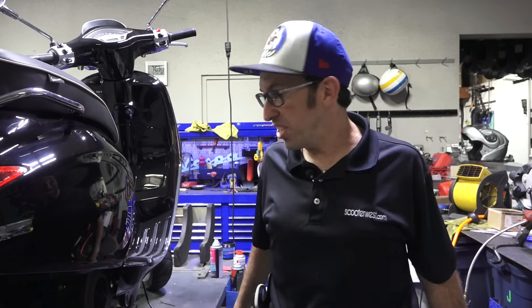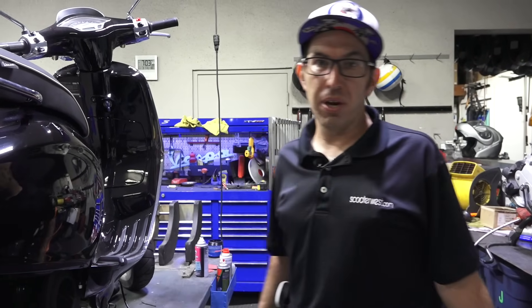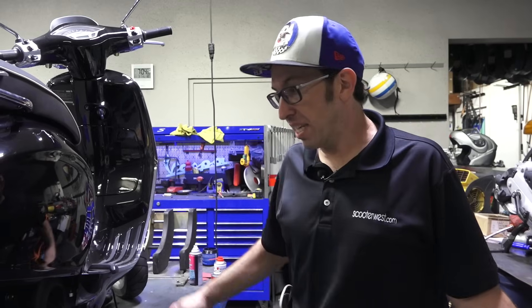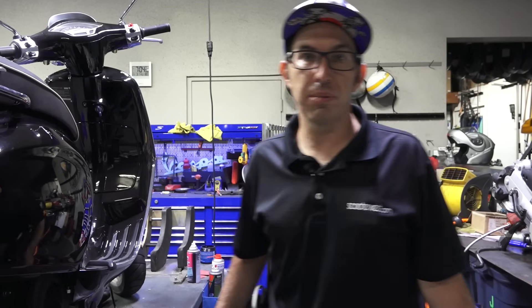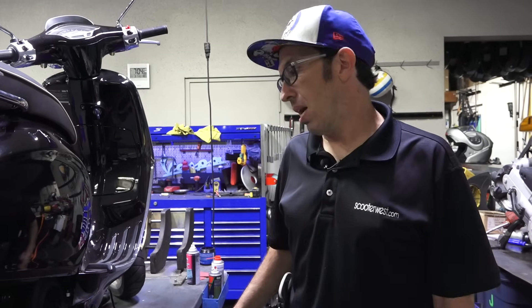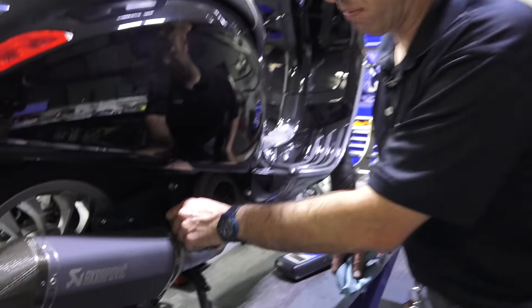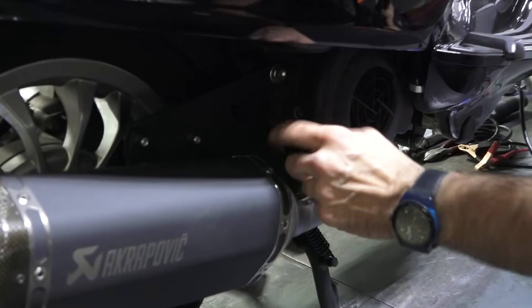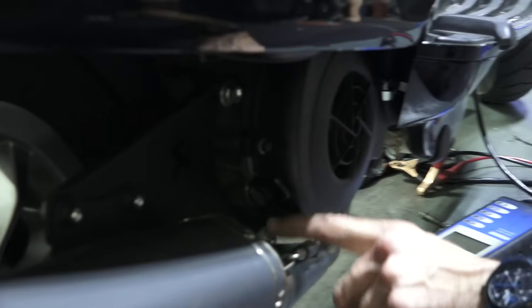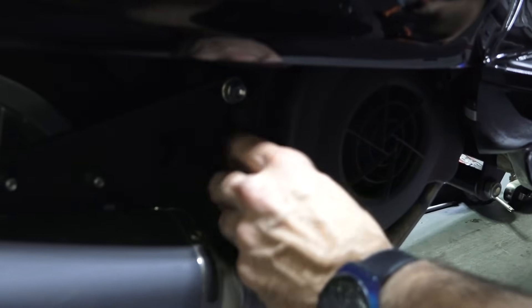Number two, you should be checking your engine oil. This bike's got a cylinder kit, so I'd be checking the oil probably every other gas stop — if you're riding it harder, it's definitely going to consume oil. A stock bike, you could probably go a thousand miles between checking the oil, but it's definitely something important to do as an owner of any of the modern four-stroke Vespas. On the right side of the engine there's a dipstick right here, and you've got to be careful — you have the header of the pipe right there and it's not something you want to touch.